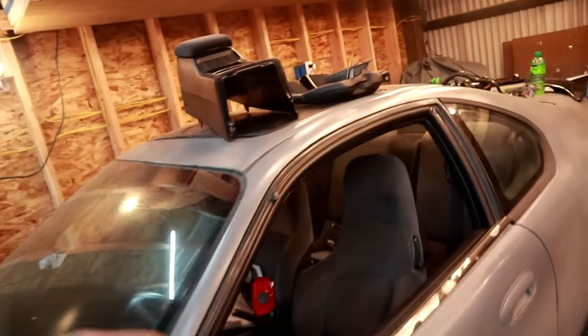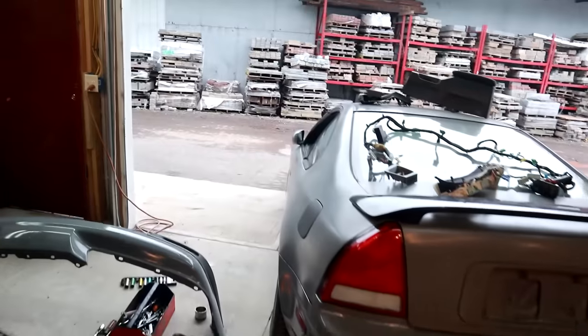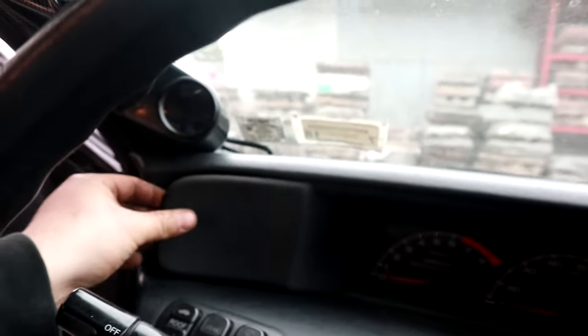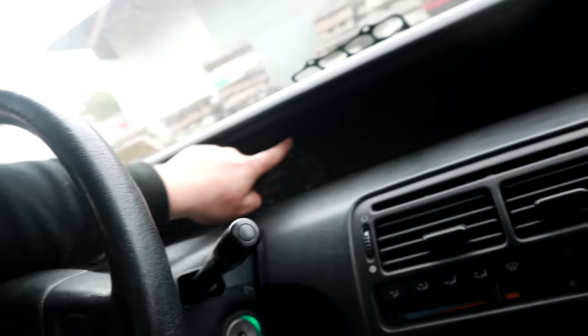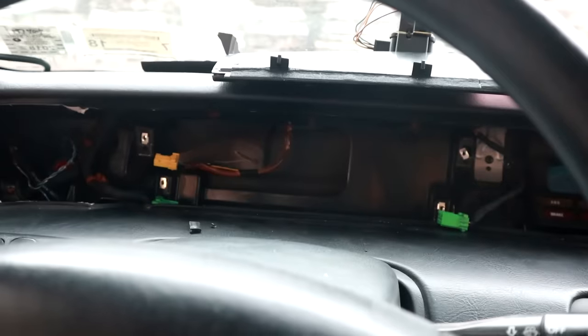Now I'm going to start installing my cool OEM JDM goodies. I pulled the car forward and I need to start taking the dash apart. Here's the rundown: you take these off - I won't be needing these anymore. Apparently I won't be needing the tweeters because there are whole speakers behind these covers. Take this bottom piece off here, very carefully. There are these little screws in here - need a stubby screwdriver. Get that top thing off, and then this thing comes off. There's a screw right there, pull it back, boom - got that out.